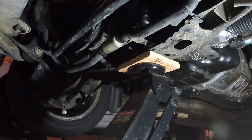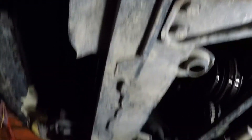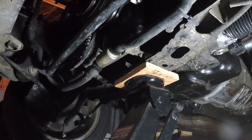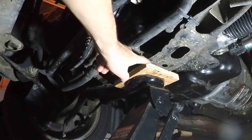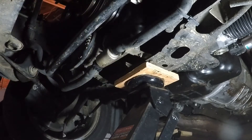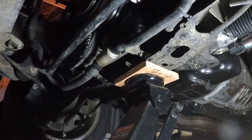Here's where you jack up the front of the car at — on the cross member. Not the radiator support. Don't do that or it'll buckle. Make sure you're on the cross member. Put a piece of wood under your jack or something like that. There's a couple of nuts right here, watch out for them. Put it under the cross member. When you put it under the cross member, you can jack the whole thing up no problem.